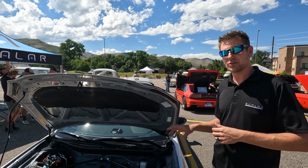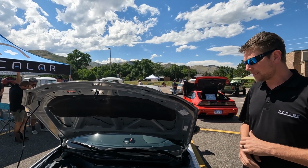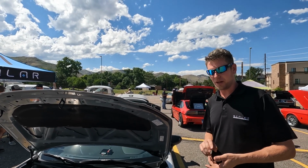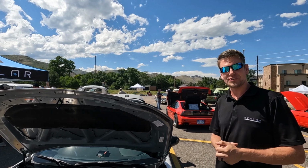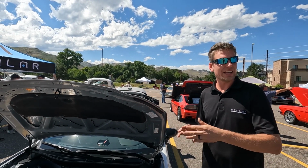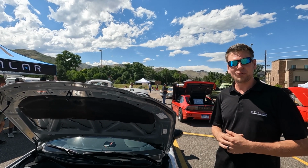We opted for the 800 volt because, for one, you can charge faster and deliver power better. Really? 800? That's cool. You don't see that a lot. No, you don't. The Porsche Taycan uses 800 volt. Even the Porsche Performance, they're using 800 volts. Tesla and most road-going vehicles are only 400 volt. 800 volt gets us the power we want, the delivery we want.